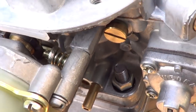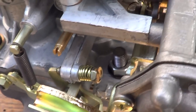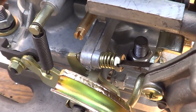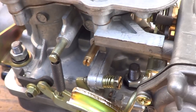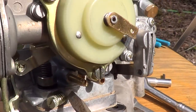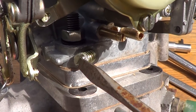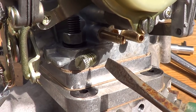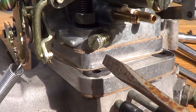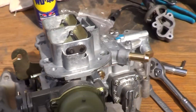Once it gets warm, it turns and then it drops down to this idle right here. Then you have your rich mixture screw — that one adjusts in and out. You're supposed to screw it in until the motor starts acting up, and then before it dies screw it out until it starts acting up again, then screw it back in halfway — basically you want it in the middle, and that makes it run perfect.